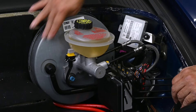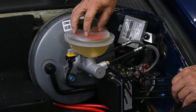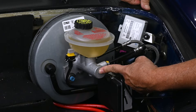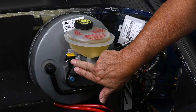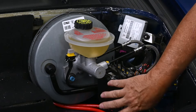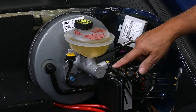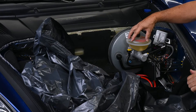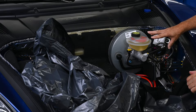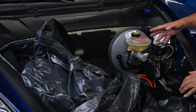So here is our brake booster — this is what gives you power brakes. This is our brake fluid reservoir, and underneath here the silver thing is our brake master cylinder. This line with a sensor connector warns you about low brake fluid. This is your anti-lock brake system, and these are the two hydraulic lines that connect to the master cylinder. We need to pull this reservoir off and break these lines loose, and of course everything here is full of hydraulic fluid — so I don't see how we can possibly do any of this without making a mess.